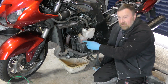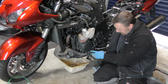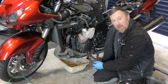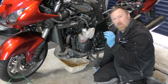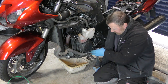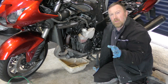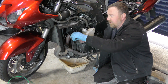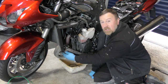The coolant was really, really low, and the drain plug was loose with some residue around it - it was obviously leaking out here. That's why the system was low, something you don't want happening. It leaks so minimally it doesn't drip on the floor, but the engine gets warm and it evaporates, leaving crystallization on it - that's how you know you've been leaking. So I'll drain the water out, refit that plug nice and tight, and put fresh coolant in. When you put the new coolant back in, make sure it's full, let it run until the thermostat opens, then top it up.